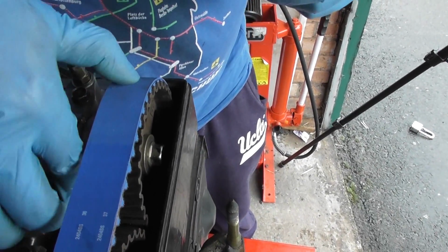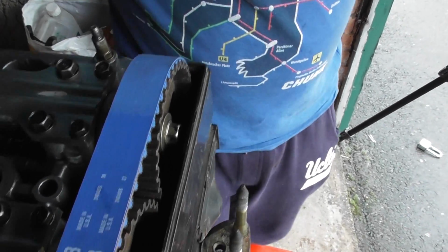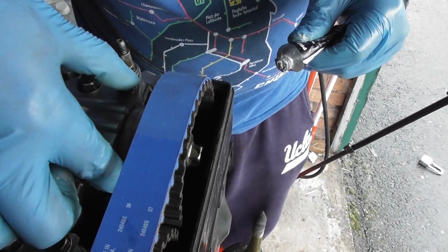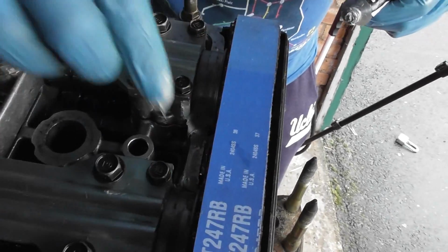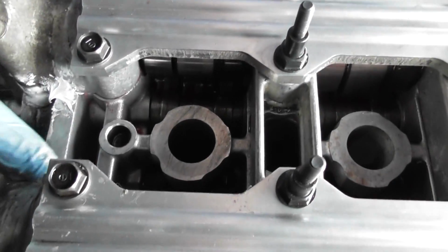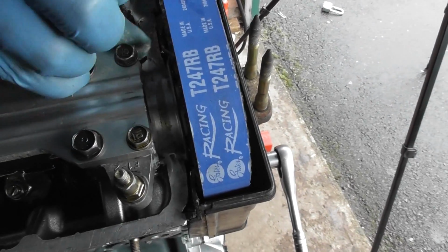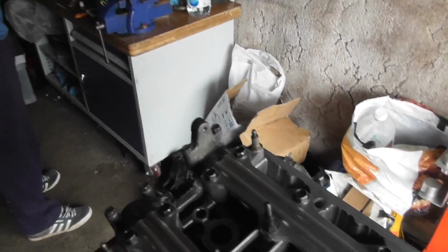Just have to use your finger. Just use my finger for this last one. That one. And just one more. In there. I'll just push it into the corner just to maintain a nice seal. Just make sure it's all consistent. Right. Trying to get Honda Bond everywhere like I am. Right, good. And then big moment.